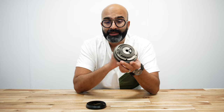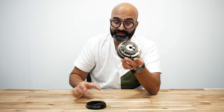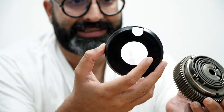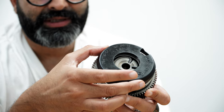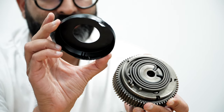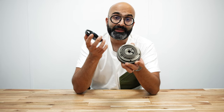This is actually the Vanos hub. The issue with the Vanos on this car is not the Vanos itself — it actually works really well compared to its predecessor. The issue is the plastic cover that goes on here from the factory. These are made out of plastic and over time they can go brittle, bits of it can fall into the engine and therefore into the oil pickups. If that happens you can get oil starvation and catastrophic failure of the engine.